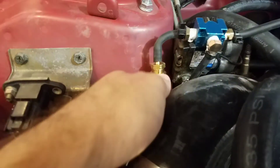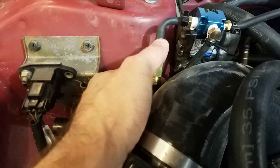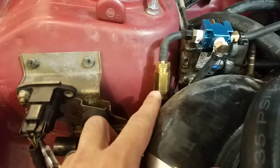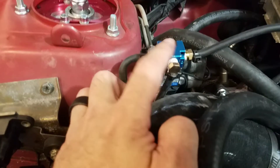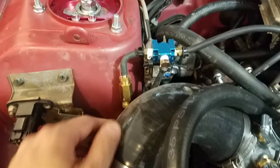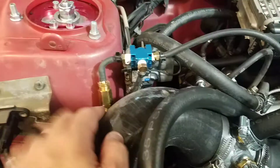It's not Subaru specific. This is the manual boost controller — what we're going to use for higher boost. It's just a brass fitting, brass fitting, and then a coupler in the middle with a spring and a ball bearing inside. I'll go over exactly how to make that. This is the three-port boost solenoid — you can pick it up on eBay, I'll post a link. It comes with these brass fittings, so really the only extra thing you'd need is possibly some hose.